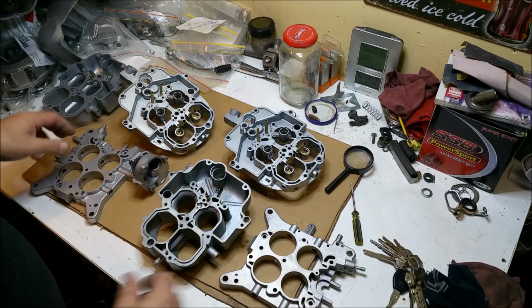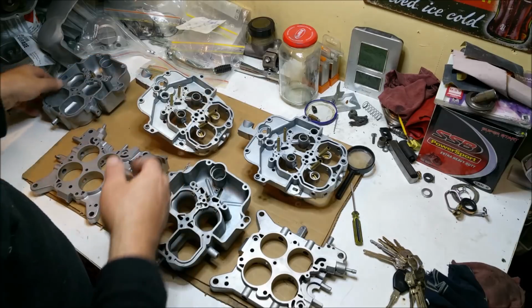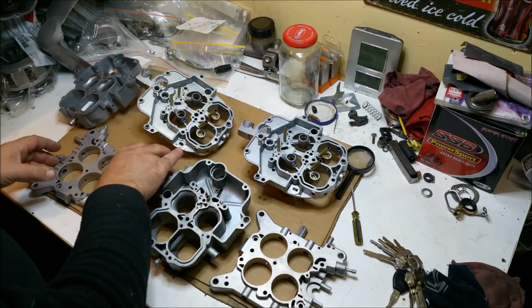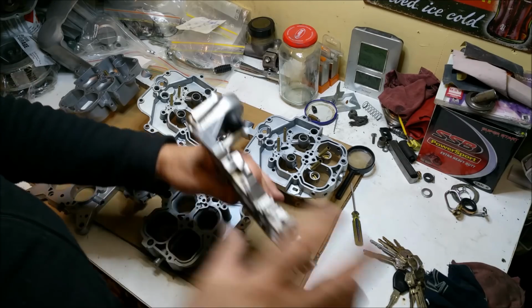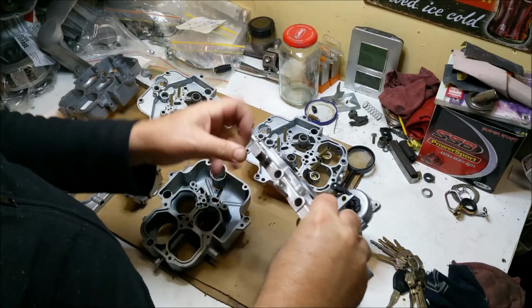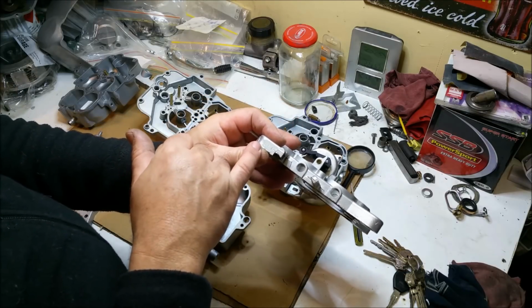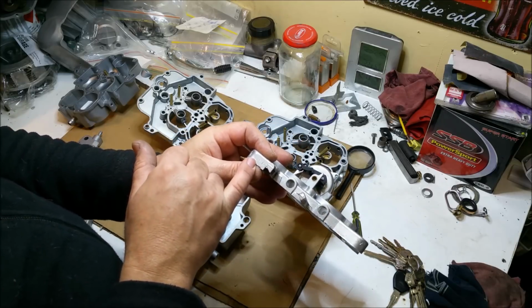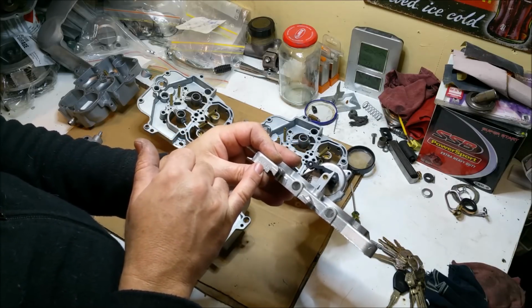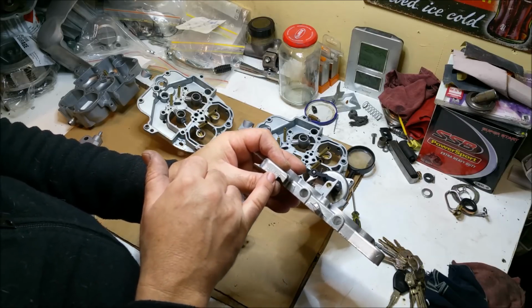Okay, so here are our carburetor parts, the housings. Now these are an identical pair of carburetors. They've both got the same numbers on them, which I always get lost. Here we go, D3FFLA. D is 1970s, 3 is the third year, 1973. F is foreign sales or Trans Am racing apparently, and F is general parts.